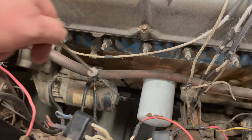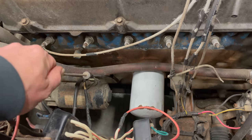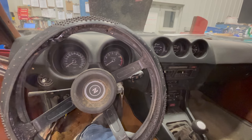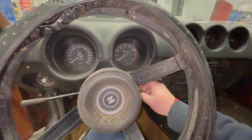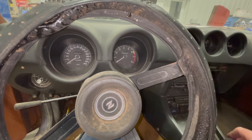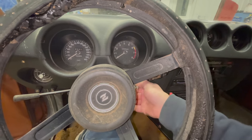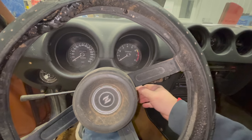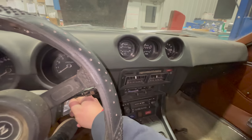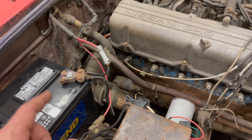Real quick I should check the oil and make sure there is some — yep, looks like there's plenty of oil in it. Here we are inside the lovely Datsun — you can probably see some dust blowing around. Let's turn the key to on. Nothing happened there. Let's hit the starter, see if anything happens. No. Okay, nothing is happening at all inside the car, nothing turns on, nothing does anything. So we are connected to the battery but we don't have any power.